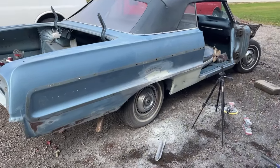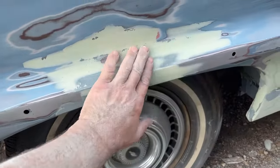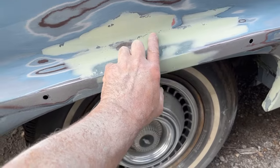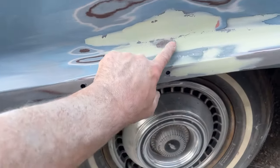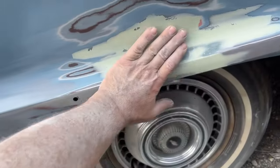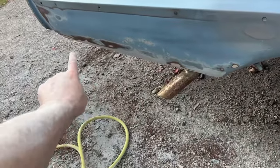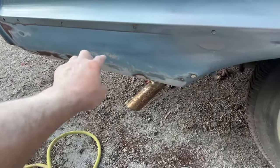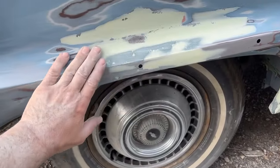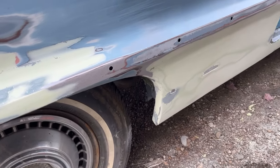So, all right, I'm going to keep sanding that up there and I'll be back in a little bit. Okay, this is pretty good now. This is the fiberglass showing through. This part of metal was a little higher, so I ground it down. So now I'm going to do one more coat on this area, that area, and down here needs a little bit because that was a little lumpy feeling, so I'm just smoothing that out. I'm going to mix a little bit of my glazing putty with my filler. I'll show you here in a second.